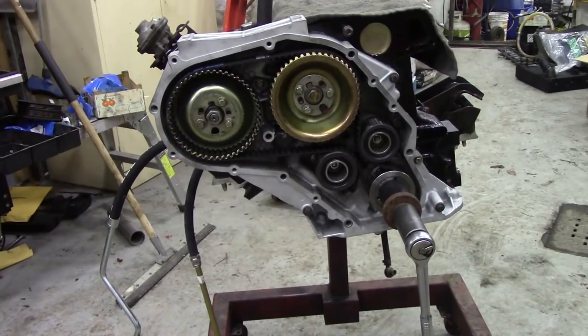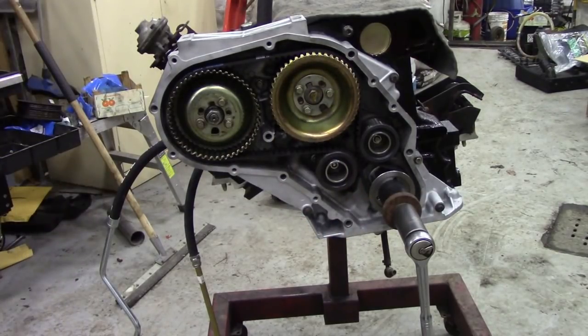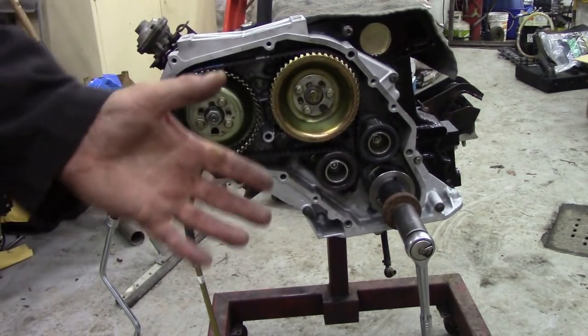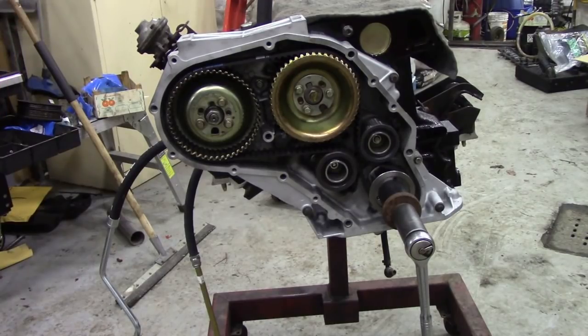I just put the belt on. If people wanted to know how I put the belt on without the flywheel — there's a little mark on the back of the casting to line up with the keyway. Seeing there's no pistons in, it's really easy to turn over. I want to see how this belt's running, so I've got a piece of plastic drain pipe cut down so that we can put the nut on, keep some tension onto the end of the crank, and then just spin it over. I'm going to move the camera so you can see what it looks like.